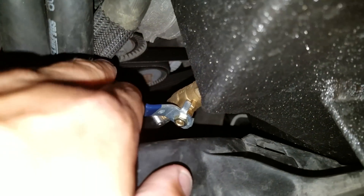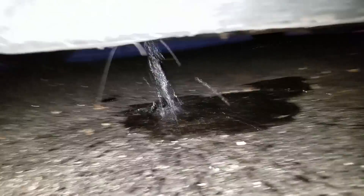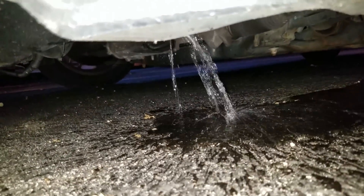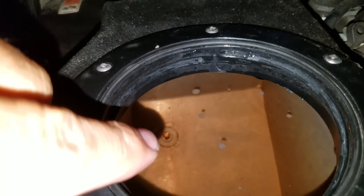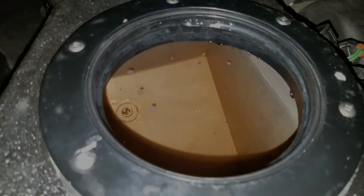Open the tank up — see it's going to be frothing. Now I'm going to drain some of it. Remember that little valve? I'm going to open it up to drain it to about a quarter. Remember that little line I put underneath — it's pissing out to the side a little bit. Get it down to the right level. If you're at the track and you make a run, this is what you're going to be doing — drain to a predetermined level, then stuff it with ice.